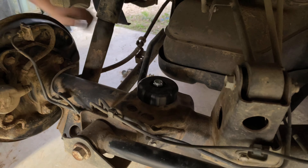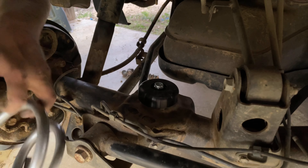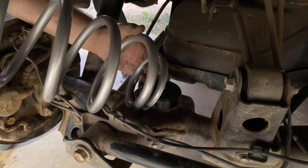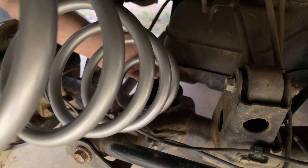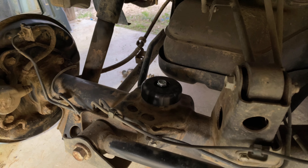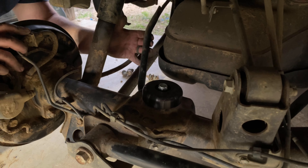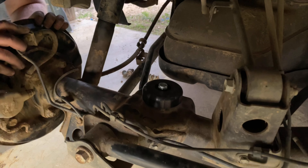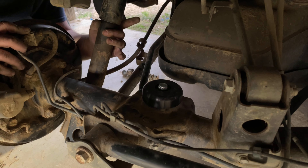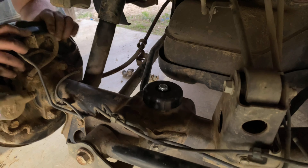That's how you'll get that on. Once you get that on, get it tightened down. The lower portion of your spring is here and the upper portion goes in there. I will use a jack on the other side to give myself some slack — it'll push this down and lift the other side up. That's why you unhook the sway bar, because if you don't, this won't happen. If you're not changing out your shock, you still need to undo the lower bolt to give you flex in this rear axle and everything. So there's your finished product on both of your isolators — I've done that to both sides.